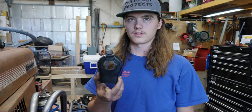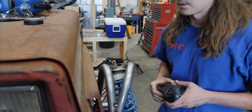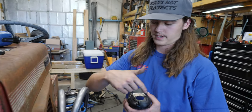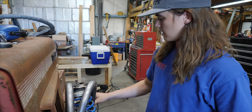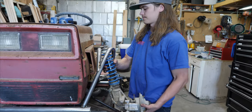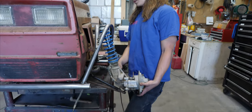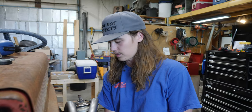We just turned one of these factory strut tops off of the four-wheeler into this little strut top on here. Basically just cut out what needed to be removed, tacked it in place, and tried to kind of get the measurements correct. Now we just need to build one for the other side and get it tacked in, and then we can try to bolt all this stuff up.